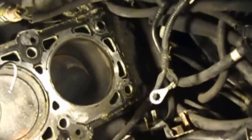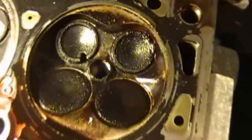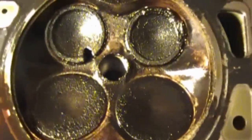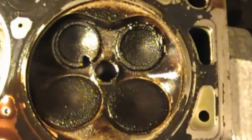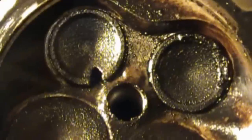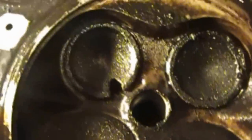Update: I've got the head off. I was going to tell you why we had a miss back on number six with no compression - well, guess what, I found it. There's the head. If you look at all these cylinders - nice and dry, nice and dry, loaded with crap - look a little closer. That valve is busted! That is your exhaust valve. There's the manifold side, there's the intake side - all good. So that is why I had the miss and no compression.